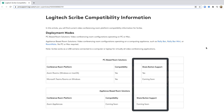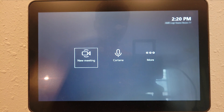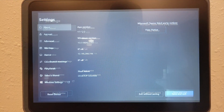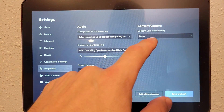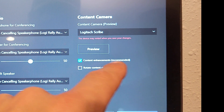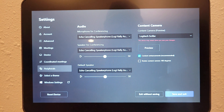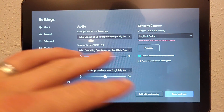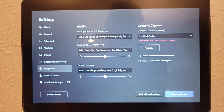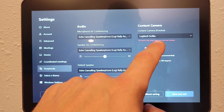For the one-touch share button mounted to the left of the whiteboard — it is currently supported on Zoom Rooms running on Windows, and will be supported on Microsoft Teams Rooms running on Windows in the near future. In this Microsoft Teams Room system we have a Logitech Tap wall-mounted. Clicking 'More,' going to Settings, entering the password, then going to Peripherals and Content Camera — it has 'none' selected. We can now see the Logitech Scribe and select it. There's a recommended setting called 'Content Enhancements' — this is the AI built into the Teams Room app for content cameras.